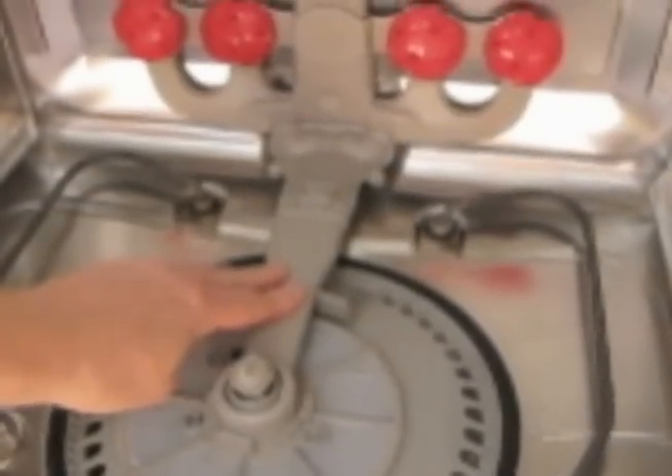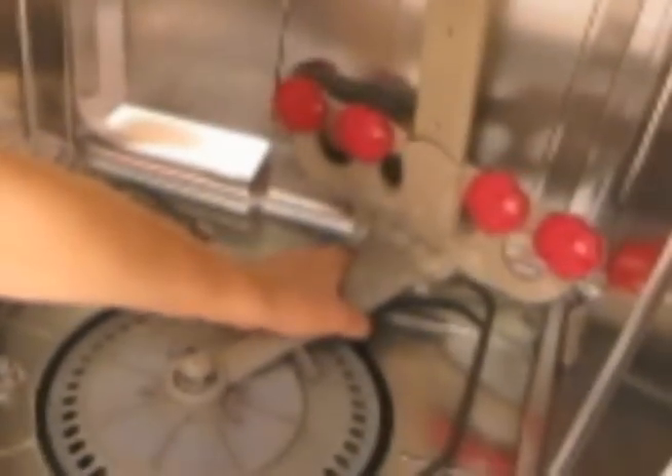We will need to remove the water feed tube and spray jet assembly from the dishwasher. These are attached by means of small clips — you can just bend them back. There are a couple on top and a couple lower down, and that should just all pop to the side. Then we will turn it and move it to one side because there is a screw underneath the water feed tube.